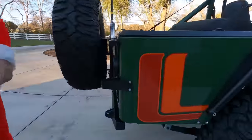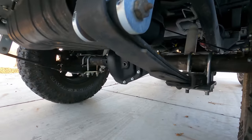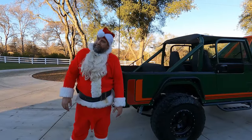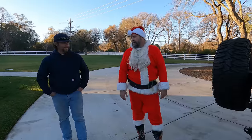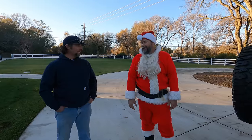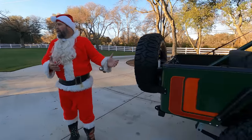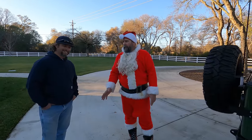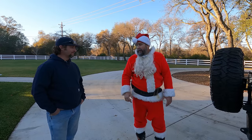When I sold it, it had a Dana 44 in the rear; now it's got a Dana 60, 35-spline, 4.10s, and a Power Lock. The girls wanted to take the Scrambler to the father-daughter dance, so coming back from ice cream John tried to do a burnout for the kids — and it popped the spider gears out of the Dana 44. I always tell people: for something you wheel maybe once a year but mostly drive to baseball practice and parties, a Dana 44 is fine. Not with a small block V8 and a manual transmission, it's not.